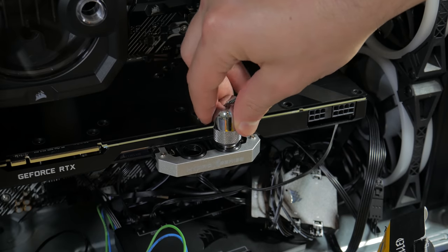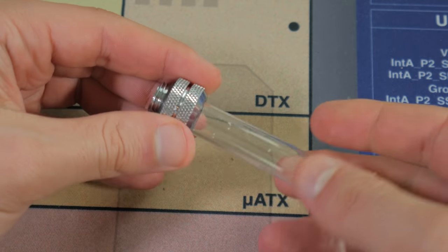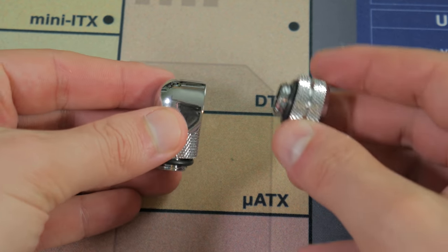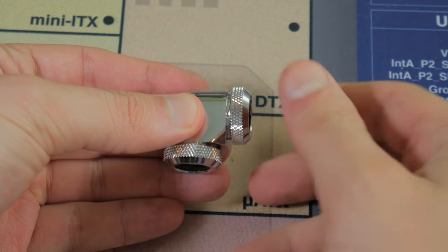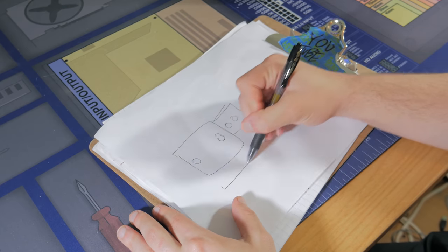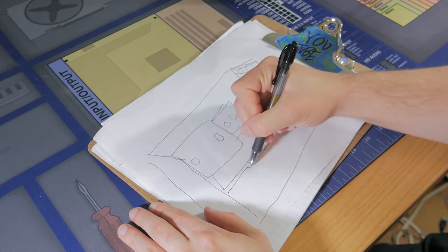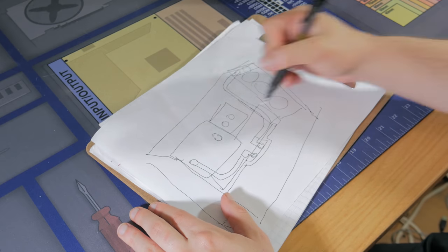Now came the scary part for me: installing tubing and fittings. There were three types of fittings I used: basic compression fittings that attach tubes to components like the water blocks, radiators, and reservoirs; right angle fittings that extend the basic compression fittings; and right angle fittings that connect two pipes together. To plan out a loop, the best thing to do — especially for a beginner — is to draw out how you're going to do your tube runs. Most of what I read online states that loop order doesn't matter, so I just went with connections that made the most sense from an ease of assembly and aesthetic perspective.